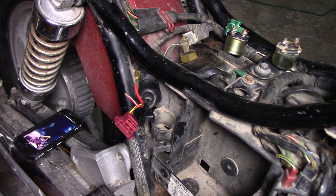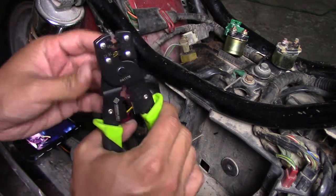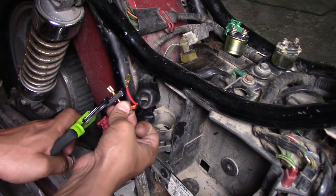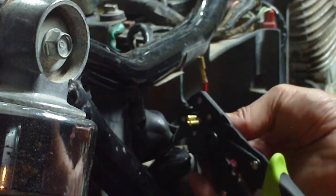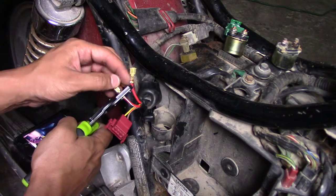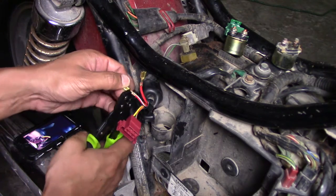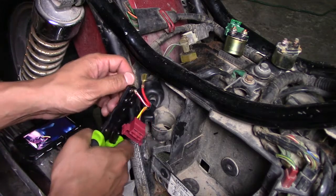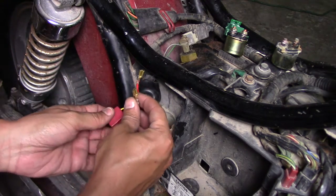So we're going to put a new connector right back on there. Put it into the crimper tool, apply light pressure, feed the wire through — you can see the wire came through — then crimp it down. I probably just didn't crimp it down enough the first time. You want to crimp it down good but not so much that you smash it — it's one of those things you get a feel for after you do it so many times. Even I mess up a couple of times, but that's one of those things about working in your garage — stuff happens but you can fix it.